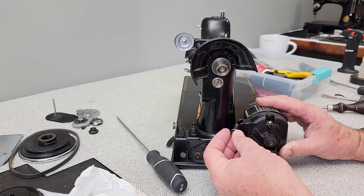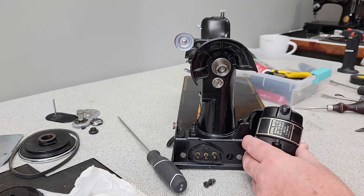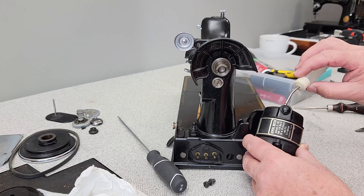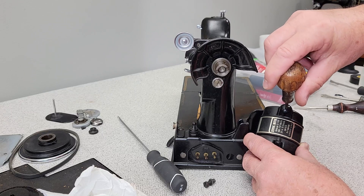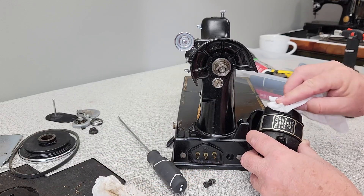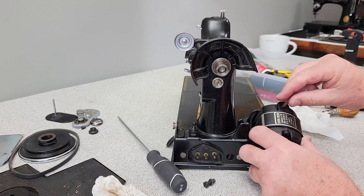I'm just cleaning the machine off with some sewing machine oil. You can take this one screw out of the casting and loosen the motor and just tip it this way so you can clean all these parts. This is the cover for the brush — it's a Bakelite cap with a slot in it. If this is extremely tight, be careful — you'll break or chip it. What I'll do is run a little bit of oil around the edge, let that soak in, and then very gently ease this out. This only needs to be finger tight, nothing more. Right away I'll wipe that oil off the edge — I don't want any getting on the brushes or down in the hole where the brush goes. Then you can just pull out your brush.